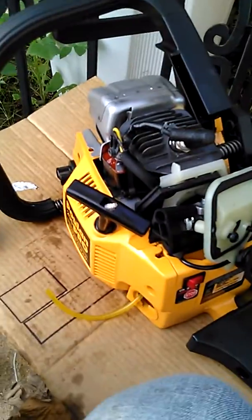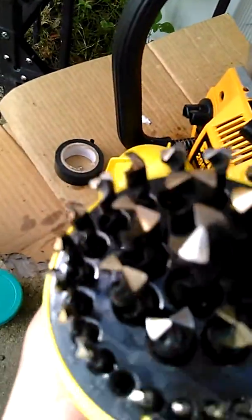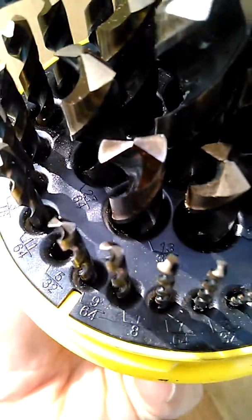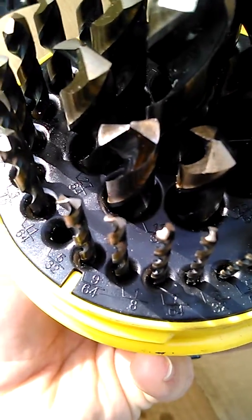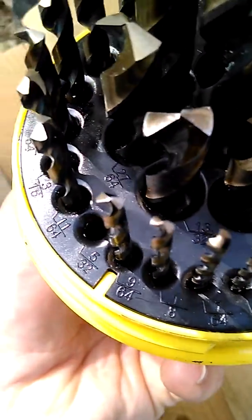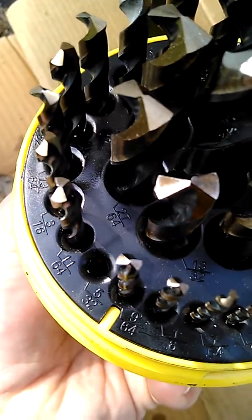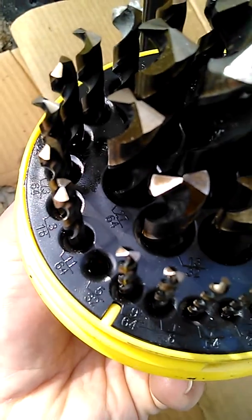I used a drill bit. First, I started smaller. I started with the 1/8, and tried it, and it just took a couple shavings off, and couldn't get the hose through. I actually broke a hose. Kept breaking all the way down until it was too short. Tried the 9/64. Still took a little bit more shavings off, and unsuccessful, breaking hoses. But the 5/32 drill bit seemed to do the trick.